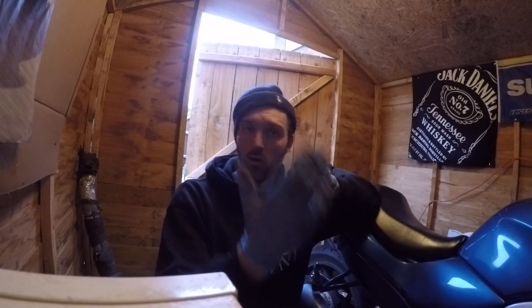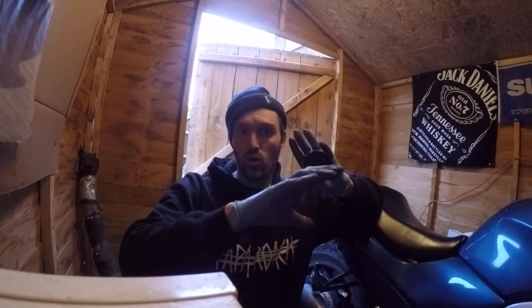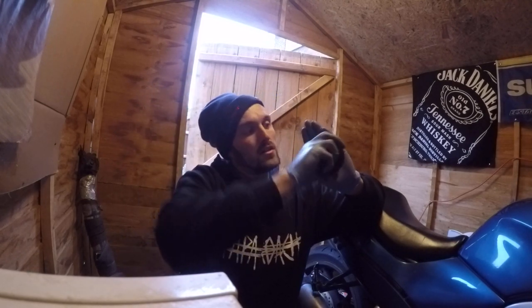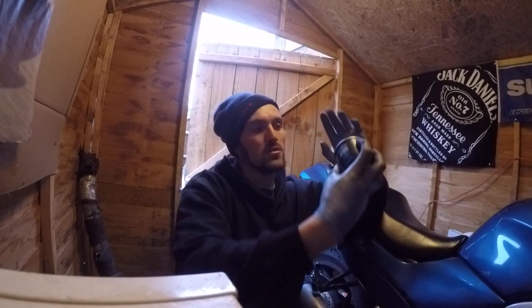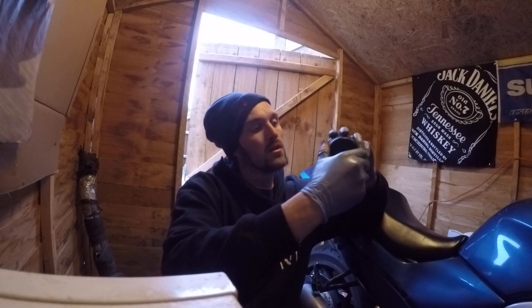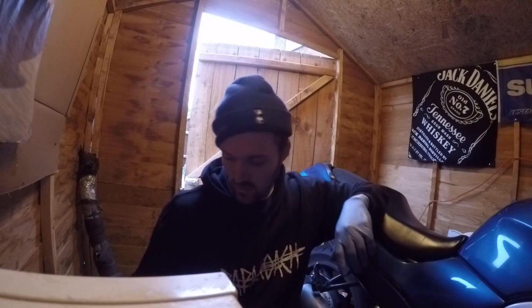So we're just going to imagine this is your oil filter on your fared bike. It's the same as on my last video, the Bandit. Literally, that just sits in your engine. If you can get a tool or a chain tool or anything on it, it's anti-clockwise to undo it, round and round, it screws off, and the same to put it back on, clockwise. So I'm just going to put the oil in now.